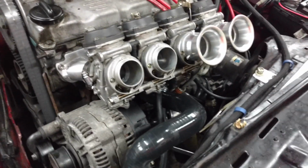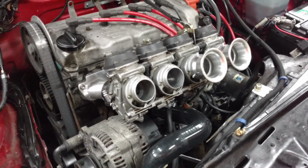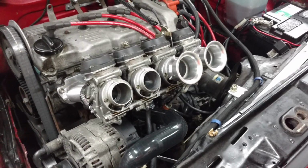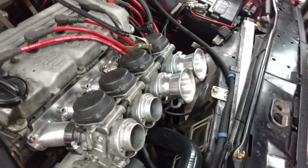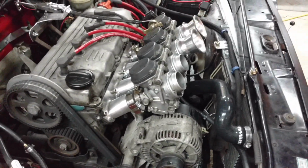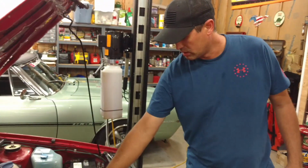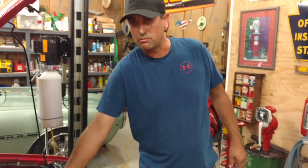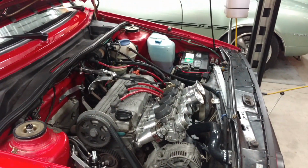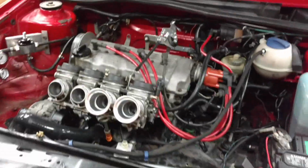And like I said, we still need to do a little bit of work. It needs more fuel. What did the research say? For what size jet did they recommend? They recommended a 1.9 mil. I only did like 1.85, but this engine's cammed and everything else, full exhaust, the whole deal. So I think I'm just a little shy. There's mastermind Jimmy there, boosted tag. Might need to go to like maybe a 2 mil. I'm thinking. Yeah. Well, there you have it. That's the update so far.